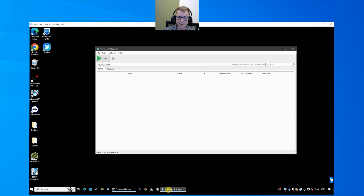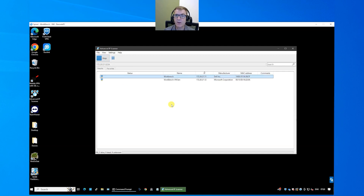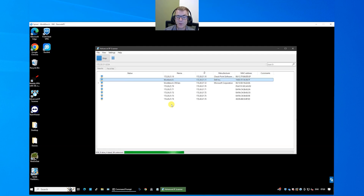I like to use a little download called IP Scan and you can grab this off the internet for free. It will run through and show you all the different IP addresses that are available, and this is sometimes the quickest way. If you're using the TP-Link app I think it will already find the device for you, but by doing this I can find all the TP-Link devices and probably find out which one is the controller so I know what IP to put in my web browser. We can see my first one here is my Omada controller.